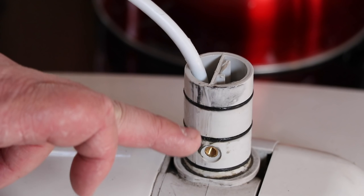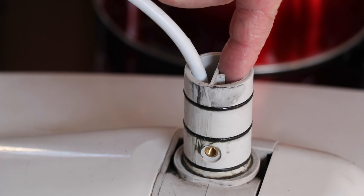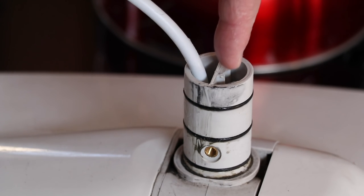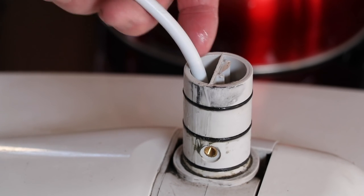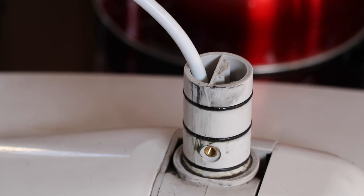This isn't the problem however. The water is not ingressing at the O-rings — the water is actually coming from inside the antenna, coming down the coax, which basically means there's a leak in the actual antenna itself. So that means we either break the antenna down, find where the leak is, and repair it. I've read online about lots of people who have done exactly that — breaking the seal on this antenna and pulling it apart to fix it. However, I'm going to go a slightly different route.